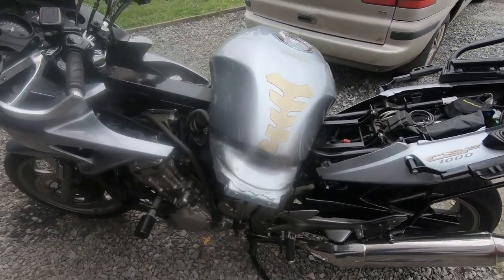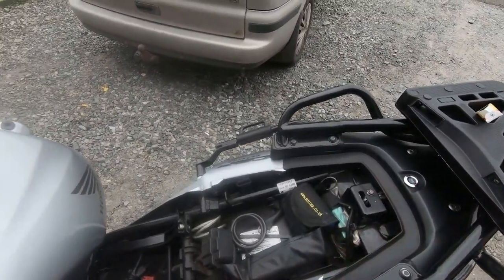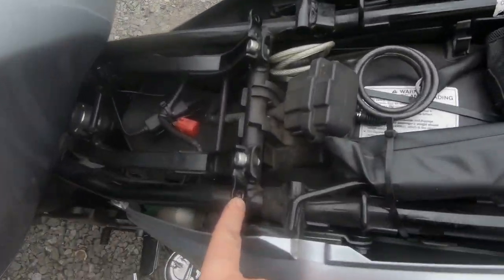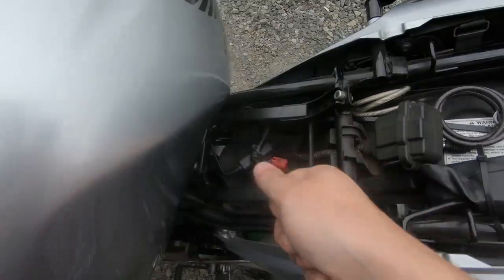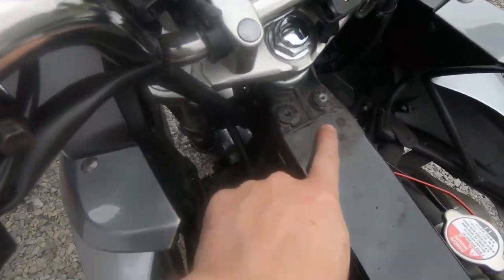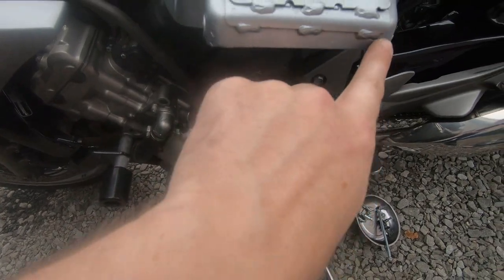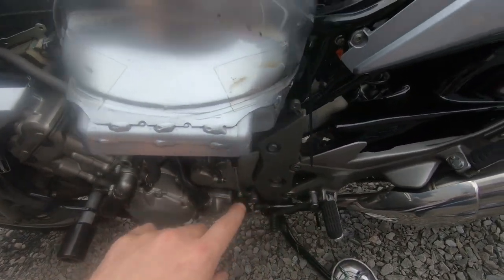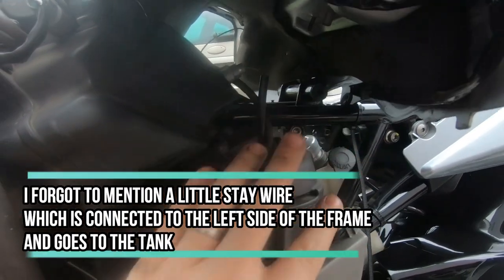To get at it, all you have to do is remove the rear seat, screw out the two screws on either side of the rear of the front seat, and then it simply slides back. Remove the two front tank bolts - those are 10mm - and the rear tank bolt across the back, which goes onto this little bracket in here. Just remove that completely.